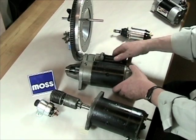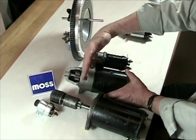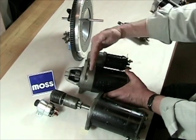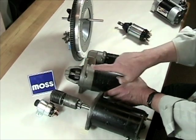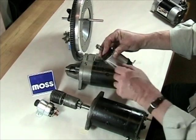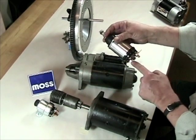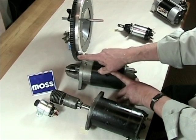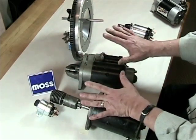Why does it do that? Well, inside this starter motor assembly is a lever. It sits right about like this and pivots on this pin right here. When the solenoid pulls, it pulls this end of the lever in. When this end gets pulled in, the other end gets kicked out, and what it does is push the pinion gear out — in other words, it goes and engages the flywheel. Going back to the solenoid: there's travel before we actually get to the point where the contacts close. That means the gear is out to the flywheel before the starter motor gets power. This is why it's called a pre-engaged starter — the gear will be engaged with the flywheel before the starter motor actually gets electricity and starts to spin. So we have a gear that's not spinning making contact. That violent event is gone.